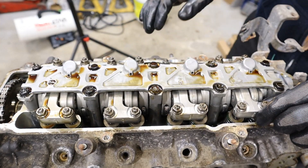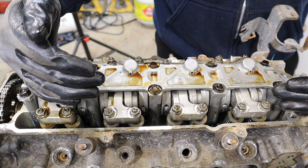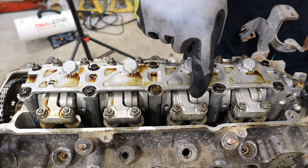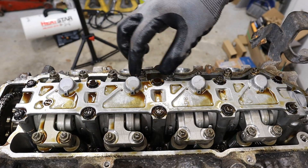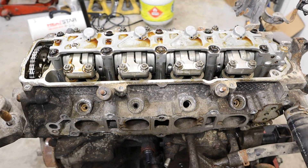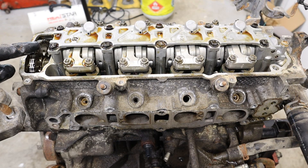That tapping noise would have made this engine quite loud, which you'd adjust with the nut over here. On the intake side we do have VTEC, which is Honda's variable valve lift. That has two rocker arms that control two different heights of cam profiles respectively. On the exhaust side we just have a single rocker arm for each valve that follows the same cam profile. Also to note, this does not have variable valve timing because it's a single overhead camshaft.